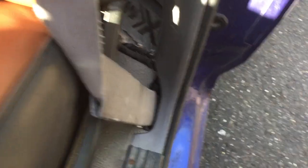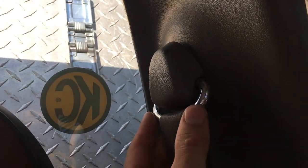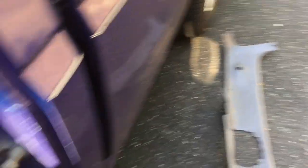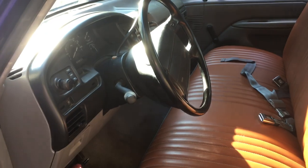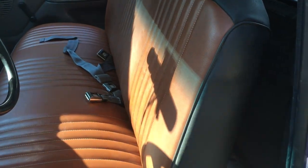There are only a few bolts holding it in. There's one bolt here that holds the end in, a bolt up here that holds this little D-ring piece, and the retractor piece is behind this panel. The big reason for moving the seat forward is so we can remove this panel to access all the different bolts. I'm going to pull that panel off. I've got the panel out of the truck — the seat is moved forward as you can see, and you can pull this latch and lean the whole thing forward. There's a retaining wire so it always wants to return to its position.